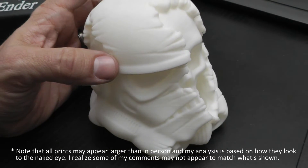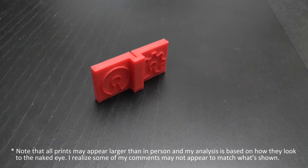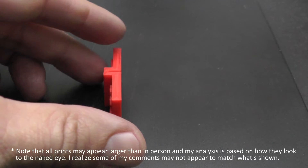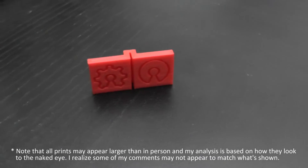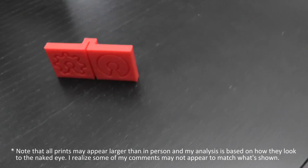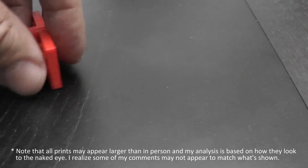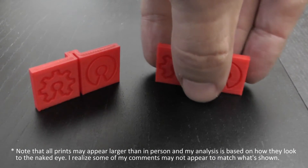Now let's move on to some of the more technical prints to look at more objective results. One of my biggest complaints on low-cost printers is ghosting due to sharp angle transitions in the print. This is where we really test the construction of the printer, as well as the settings for jerk and acceleration in the slicer — all of which were left as they came in the profile from Creality. This first small ghosting test from Thingiverse has an open source and open builds logo on both sides, one embossed and one debossed. Printed at 50mm/s and again at 100mm/s, there was no visible ghosting on any edge.